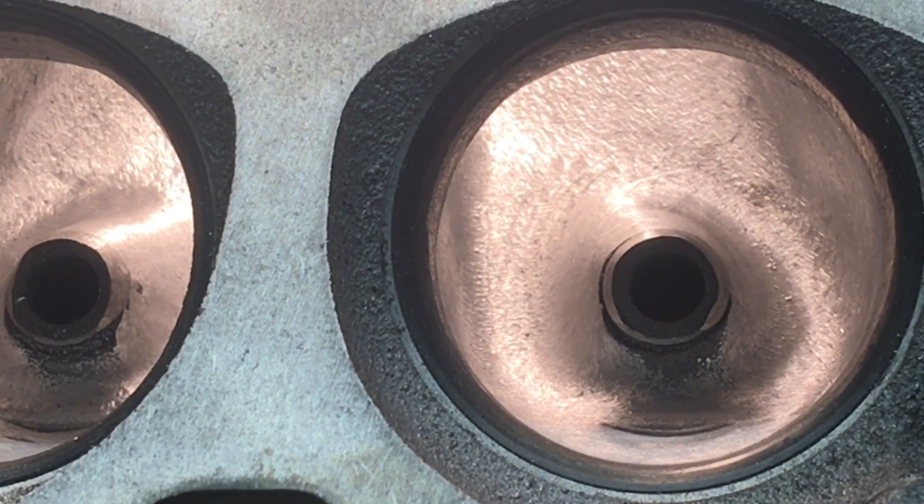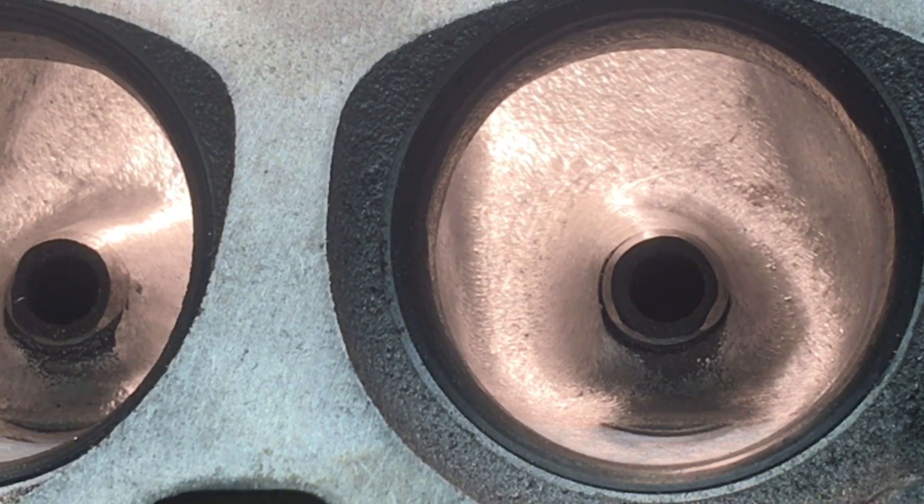This gives me a pretty decent angle to show more work, more process, as I went from my initial rough cut to my medium cut, my shaping, eventually going to the finer cuts, eventually getting to the sanding rolls. This is why the porting process should be multi-stage — not just going in willy-nilly with the most aggressive burr you can find trying to remove a bunch of material, because that's not how you end up with a properly textured, shaped, smooth surface. You'll end up putting gouges, dips, and troughs in your material if you get too aggressive.